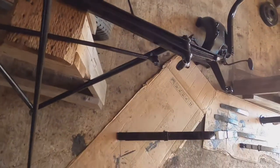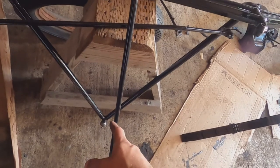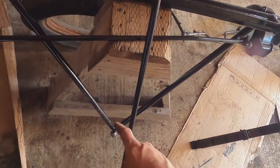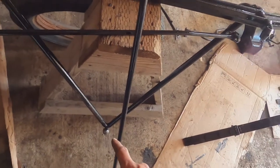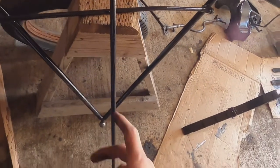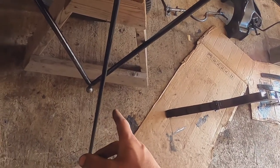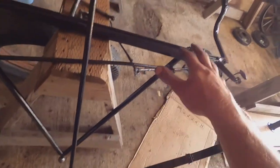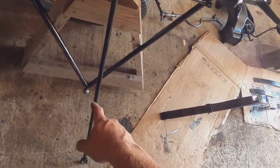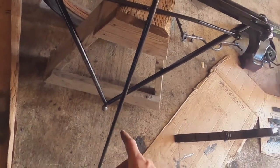That's all of the interesting parts of this front axle. We also have the two radius arms with the ball joint that joins to the front of the transmission. That ball joint is for the suspension. It gets a little more heavy abuse than the steering — if you hit something on one side, it transfers along that triangle to that ball joint. It's a bit more of a wear item, but it seems to be okay. It's pretty round, so I'm just going to leave it as it is.